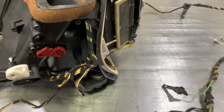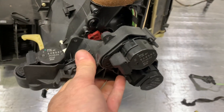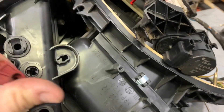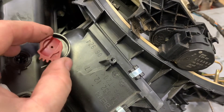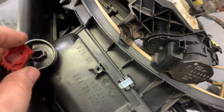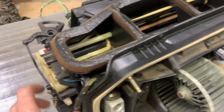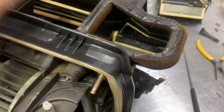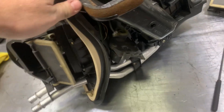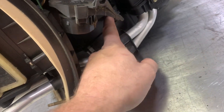In comparison, this guy was way easier to remove — just a couple of screws, pop this one off, and it came right out. I had to pull the little red actuator off of this one like we did the other side, but the manual one does not have anything in this place. This one is keyed so it's a little tricky to get out if it's not lined up properly. I got the harness routed in between here now. You have to split the case because there are a few screws that hold the front back, then route it over and pull this stepper motor off — it looks like it's for the recirc doors — to replace the stepper motor wiring and the evap temp sensor.